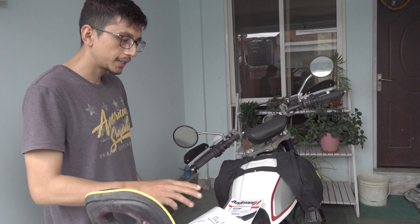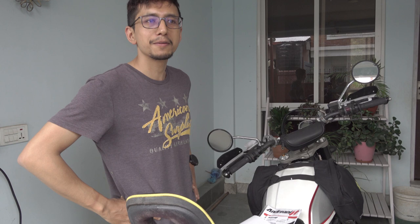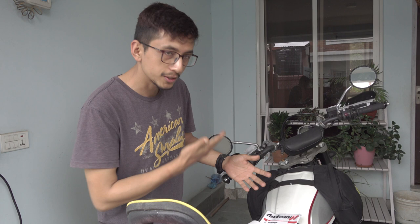Basically, preload is the amount of load you have on the spring. Think of it like an air mattress — the more air you have, the mattress is more stiff and doesn't compress down. If the air mattress has less air, it's going to sag all the way down, which is not good and not comfortable. Too much air and it's going to be pretty hard and bumpy. So we want that air mattress to sag to about one third of the rear suspension travel.